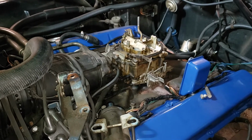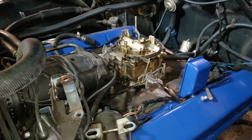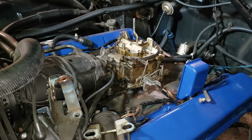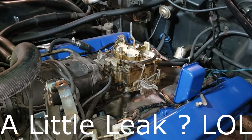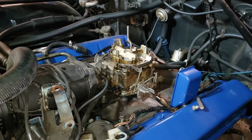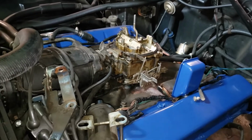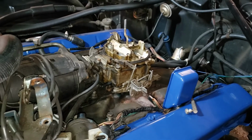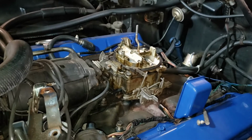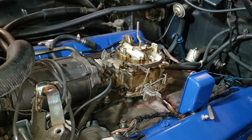All right, we're going to switch gears over to the Cadillac. The old Rochester Quadrajet from '71 here, I think we might have a little bit of a leak out of the casting well plugs out of the bottom of the carburetor. The old car runs really well going down the road, but at idle it still gets a little jittery now and again, and the idle just isn't as smooth as it ought to be.